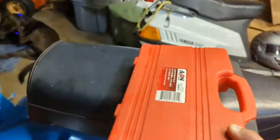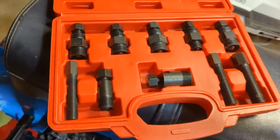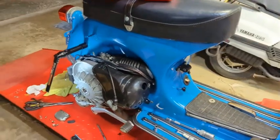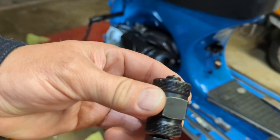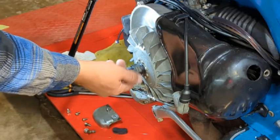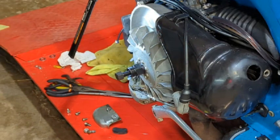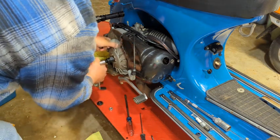Okay, let's see what we have here. Bought this off of Amazon. I don't know how much it was. Maybe I'll put a link in the description. And I'm pretty sure it's this big guy with the big hole. So you need to set you up in the stand here. Show us how to pin that pops out. We unscrew that. Goes down. Just screw it in. Now when we wrench on this, it'll pull the flywheel off of there. That'll work.